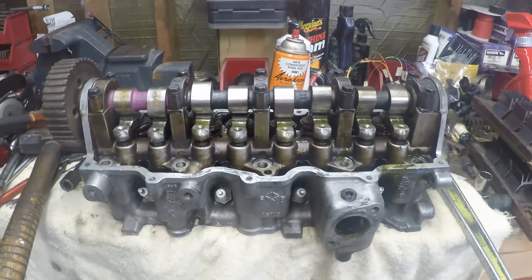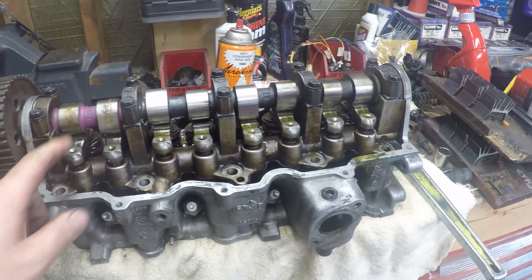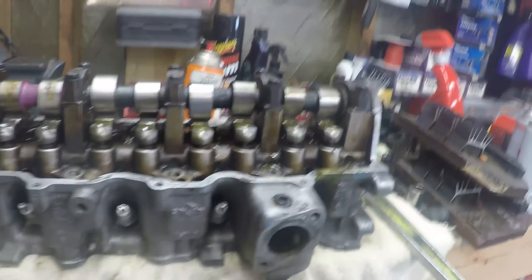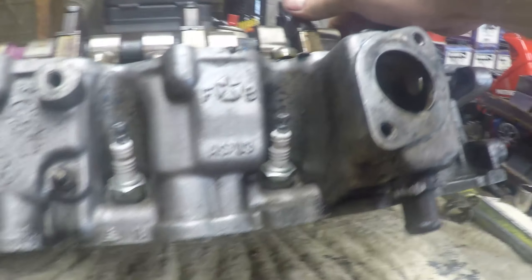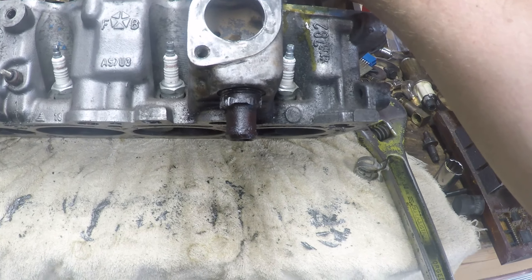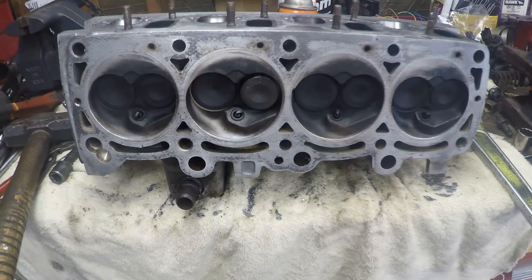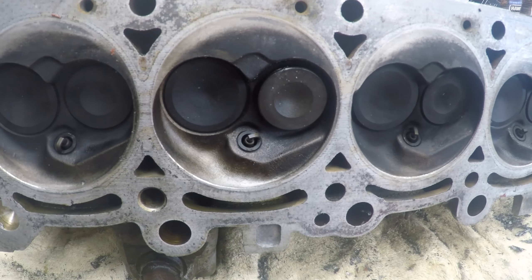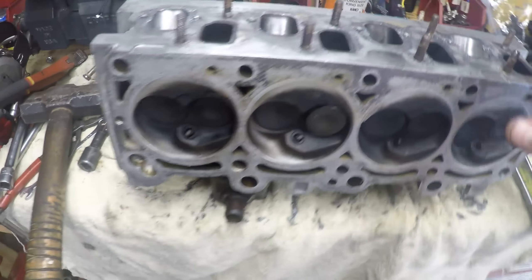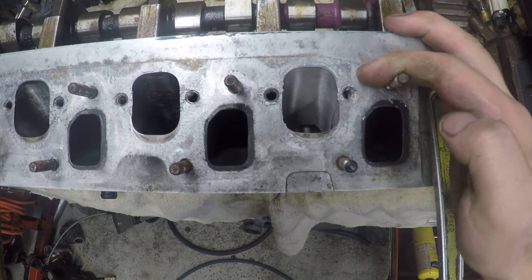We've got a Mopar purple camshaft here. It's been in this head for a little while — there's almost more of a grease than anything on there — but we're going to get that out. We'll be removing the fitting here that's all chewed up. This is the Great Lakes Club Car head from years ago. The chambers are untouched and the valves are stock. However, when you get around to this side, it's pretty easy to see that the intake has been gasket matched.